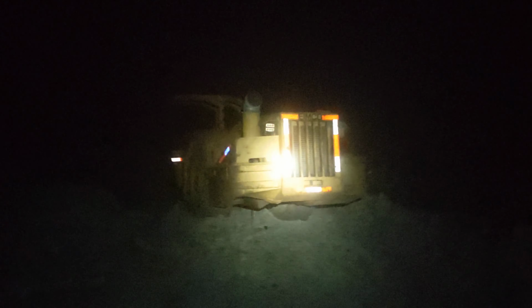All right, folks, we got that last load up here to the road dump, and Big Chungus is up here. The reason I didn't dump the truck is that it's needed to jump Big Chungus because I'm not sure if the batteries on this machine are toast, if the electrical system isn't charging them for whatever reason, or possibly both. Both is probable, but it needs a little bit of help to get started. And the young buggy needs to be loaded to have enough traction to get up this hill. I've been steadily improving the quality of the road, but it's still a little bit spooky.